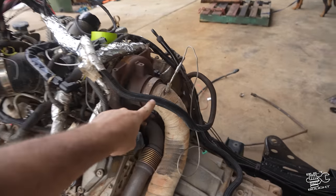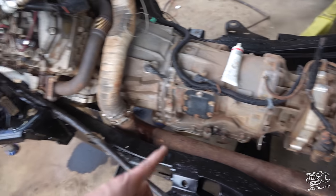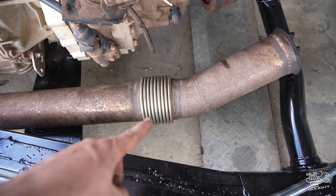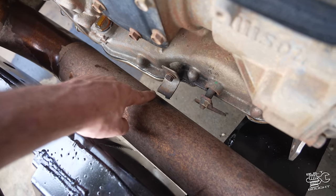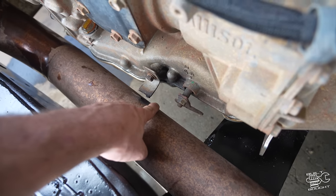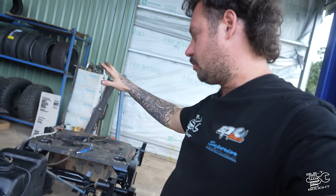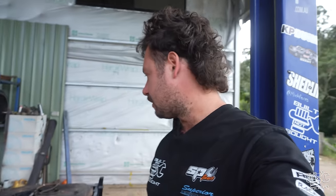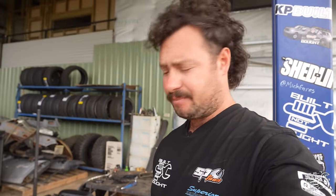I have put the dump pipe on, which was fine, but then I discovered down here that we have a cracked bracket. That section of the exhaust should remain rigid with the motor — it's mounted to the gearbox because the flex joint is there, and from there back it's all rubber mounted. So I'm going to re-weld this bracket and add a little gusset. It was just TIG welded along that section but I'm going to make a little triangulated brace down to the side there and fix that join. I'm probably going to wait until more of the back is together before finishing the exhaust. I do want to change the way they come out the back of the tray — I have a new tray canopy coming, so we won't let the cat out of the bag yet. Let's rip the TIG out and fix this little bracket.